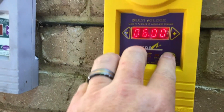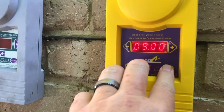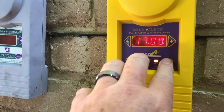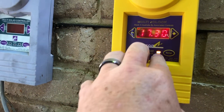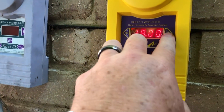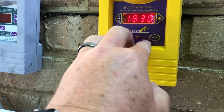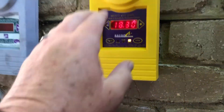To set a timer, press the Setup button and keep pressing until you get to the block you want. I'm going to get through to five — block 16, that's four o'clock. Then you go through to 5:30, press plus — that'll turn that half-block on. Then go through to six and press plus — that turns that block on.